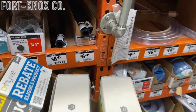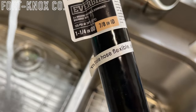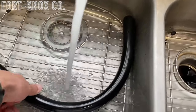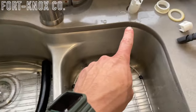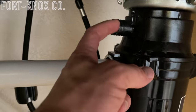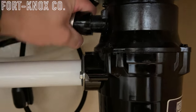I'm going to Home Depot — you can find these tubes for about six to seven dollars, or order from Amazon for same-day or next-day delivery. These tubes have thicker walls and are more rigid, so it's recommended you soak them in hot water to make them more flexible so you can bend them onto the hose fittings properly. Once it's soaked, push it onto the bottom fitting of your air gap, re-secure the hose clamp, and do the same on your garbage disposal.